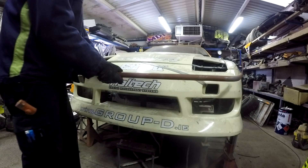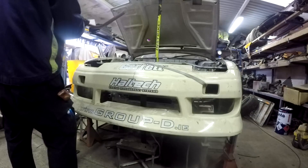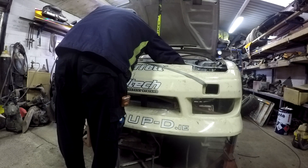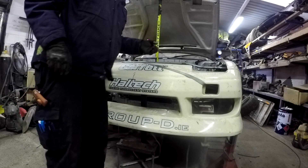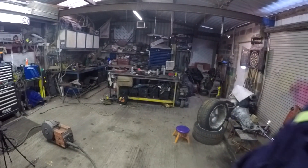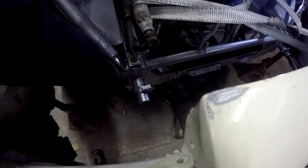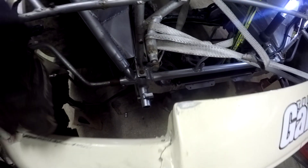It's now bent all the way along and against the bumper — it looks okay. Next job is to fit it into the bumper and make sure it fits in there, and if that's good I can start building the rest of the support for the bumper bar. It fits pretty good — I've got it held in with a couple of clamps. Next I'm going to make up the support: it's going to come off the end here where it was just a bolt or quick release through it, so I'm going to bring out a bit of quarter inch tube and take some legs up to the bumper support.